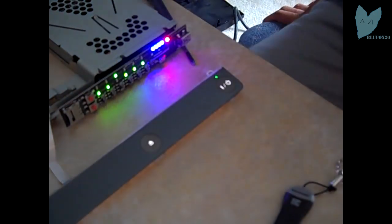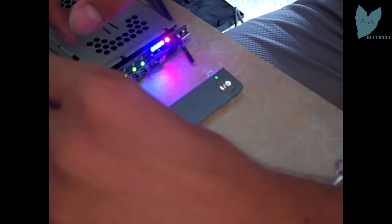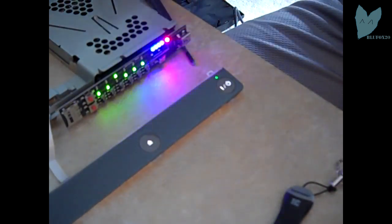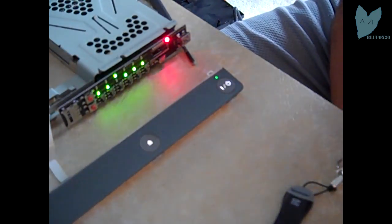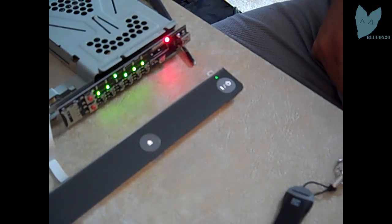Okay, I'm back at my PS3 here to make my second backup. You want to make 3 backups just to be sure that if your PS3 gets bricked, you have good, identical backups, and you can fix your PS3. And this is also to make sure that your clip is seated properly, or if you decided to use the E3 linker, my bad, I have a cold, you can be sure that it's connected properly and everything's good.